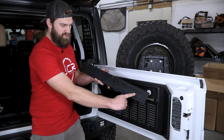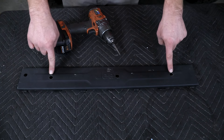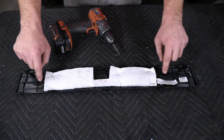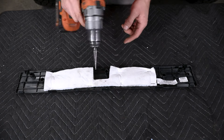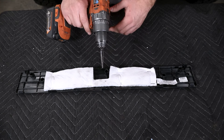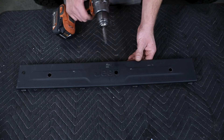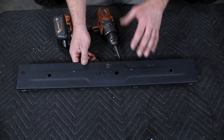We'll be drilling the two holes you see here to start with, using a couple of marks on the back side as our locating points. Flip it over — you're going to use these two standoffs, the two round ones toward the center of this panel vertically, and drill a half-inch hole right through the center of those. I have a step bit or unibit here — these work really well in plastic since it can serve as your pilot hole and allow you to gradually step up to make a nice clean hole. You could also use conventional twist drills, stepping up through multiple sizes until you get to half inch. Since ours are already drilled, it's pretty easy and straightforward — easier than any metal surface.